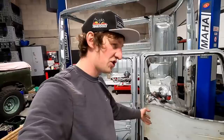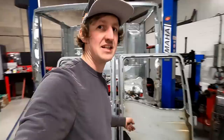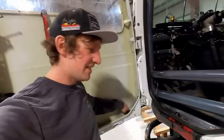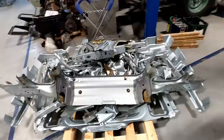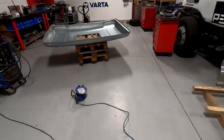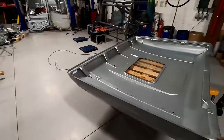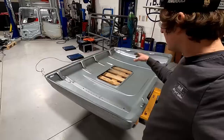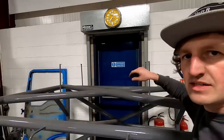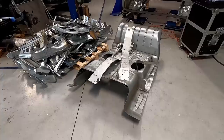The other reason we cut everything out is that if we're in a crash and the door gets dented, we can straighten it out really quickly and easily — you can see the race truck has had a rub in the last race and it's easy to get in with a hammer and sort it. You can see all the steel we've collected from the cab, including the roof. The roof is now a single skin and really flexible, but we're not worried as it'll be bolted to the cab structure and pinned to the roll cage.